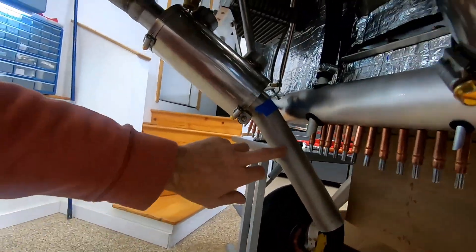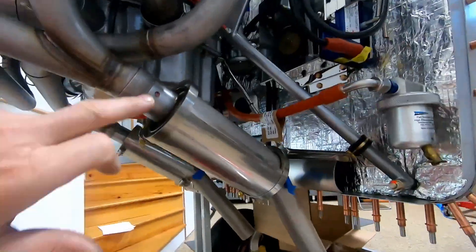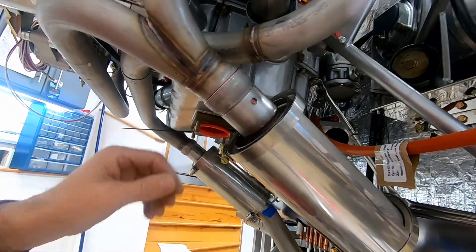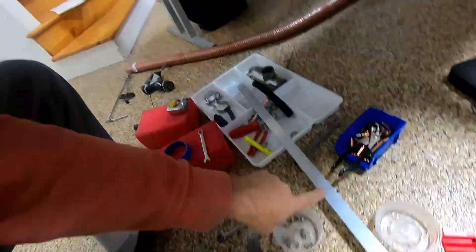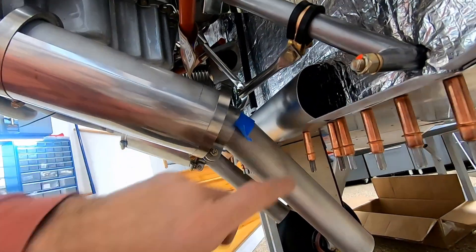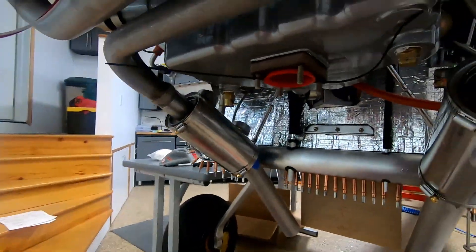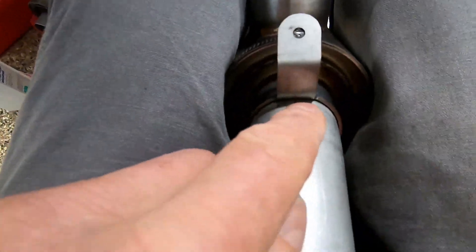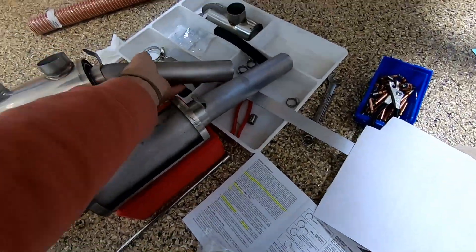What I'm going to do now is pull these off. I put some tape on here because I really like the position that the exhaust is in. I'm going to drill these holes to align it — we always have the ball joints to fine tune it anyway. I put the tape on here, then put that metal bar over there to mark top dead center of the pipe. So I'm going to clamp these guys on, drill that hole, and piece by piece get it into position.